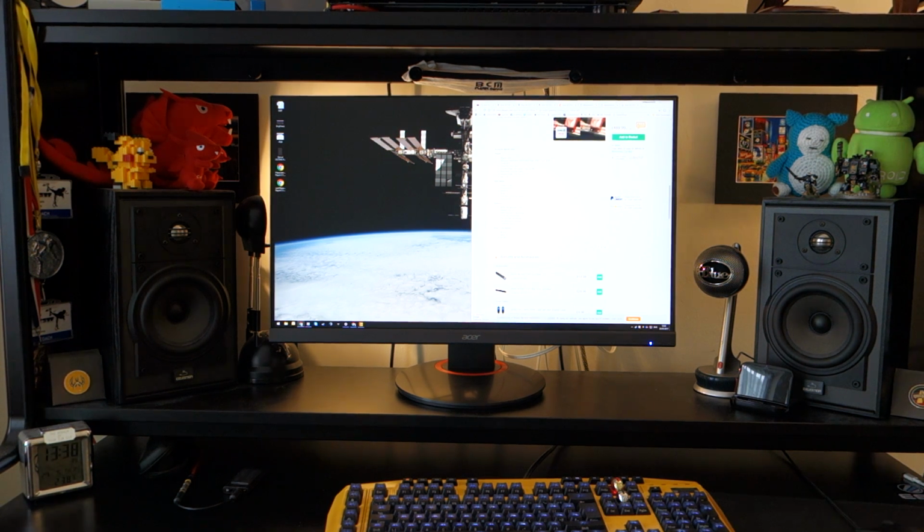So what about its specifications? Now the new monitor has a 27-inch panel, with 2560x1440, so 1440p, that runs 144 Hz despite eBuy's incorrect 60 Hz description. It has an IPS panel with a 4 millisecond response time, at least that is quoted. It comes with a VESA 100x100 mount that you can add yourself. It has 2x2 watt speakers, which are in all honesty quite useless unless you use it for Windows notifications.